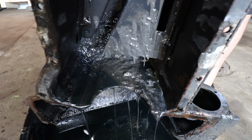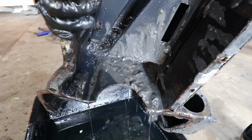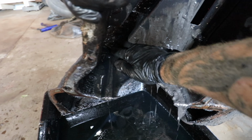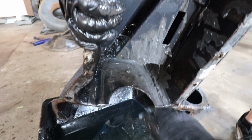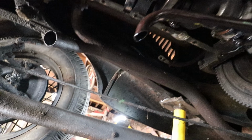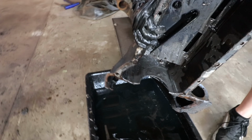Oh God. Clean your oil pans out before you start your barn finds. I'm lazy, but on a car like this, this could have been catastrophic. Especially because on these early cars, there is no screen. They figured that out a little later on, so you definitely don't want that getting picked up and ground into the oil pump.